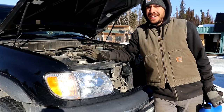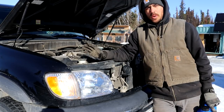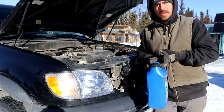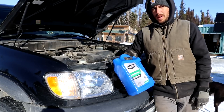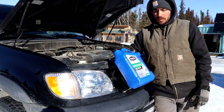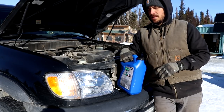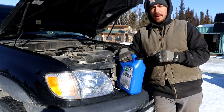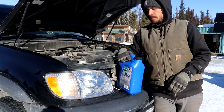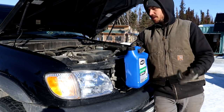We've got the Tundra all warmed up. The oil change in these trucks is pretty easy. You do need to remove the skid plate, which is only about five bolts. I just use my impact driver to get those off, drain the oil out, change the oil filter, and refill it with oil and you're done. As far as what oil we use, I pretty much always just use what's on sale. We did run synthetic in this for a while when we first got the truck, but we change the oil pretty regularly, so we kind of just switched over to what was cheapest. We use a 5W30.